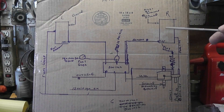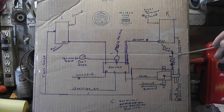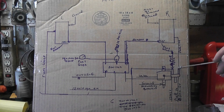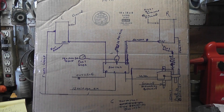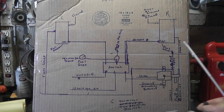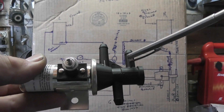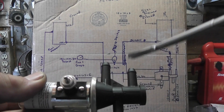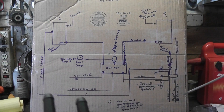Here's your right fuel tank — this is your ground. The fuel line goes out and you can go either way, it doesn't matter. But the way I've got this diagram done, it goes to this inlet, and this is the one that's energized — this is the one that gets the 12 volts from the switch. That opens it up and allows fuel to go in, so that one goes from the switch.